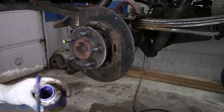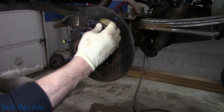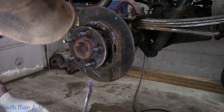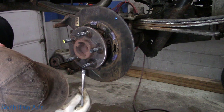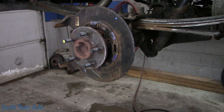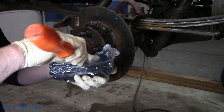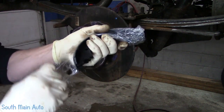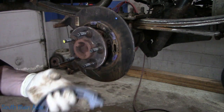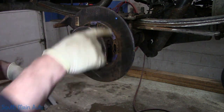Now that everything's cleaned off, we are going to lubricate our pads. I'm just using caliper grease — you can use Never-Seize if you want, whatever your poison is. This stuff's pretty gummy and sticks around for a while. It's just like doing rear brake shoes on a set of drum brakes, same process, minus the wheel cylinder. Get some brake shoes. If you want to keep them clean you can take some masking tape over the ends of each one, or just don't get them real dirty, or if you do use brake clean — but not so much that you get rid of all your mounting lube. There's a balance there.